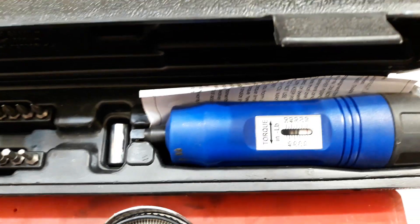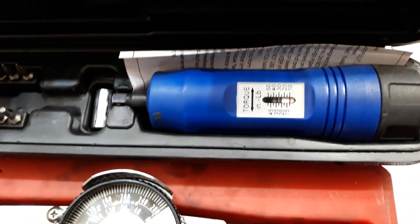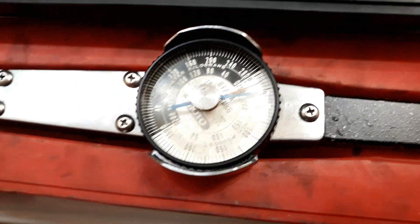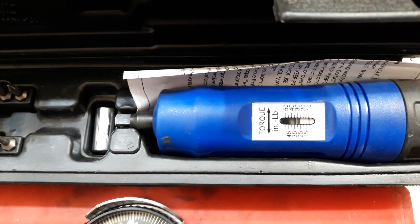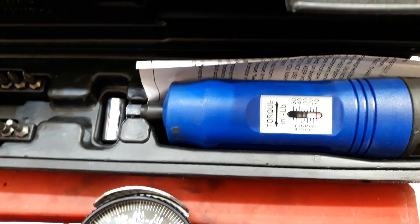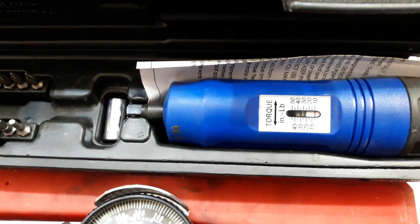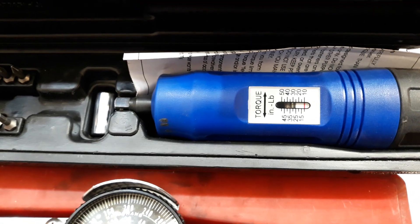On injectors these days, everything's electric and most of them you have to torque down. I know Cummins you do, and the old CATs you have to as well — except for the C13, which has that four-wire push-in. If you've been doing it the flat-rate way — just feeling it until it's snug — we've had injectors come loose and start misfiring because they were under-tightened, and we've had injectors misfire because they were over-tightened, stretching the top of the hold-down bolt so it lets go through thermal cycling. Plain and simple: over-torqued.